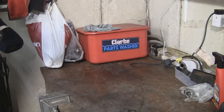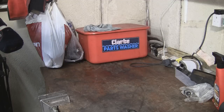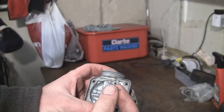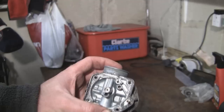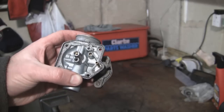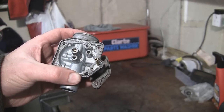Handy tip: please take a photo if you're thinking of doing this. It's alright for me because I've just filmed this, which will help me greatly if I've got any difficulties getting it back together. Just one little final thing I didn't notice happen - there's actually this pin that sits through the float here that actually dropped out when I undid the Phillips screw on the top and took the needle out. So make sure that doesn't drop out as it just did with me - that all needs to go back in as well. Just a quick note: I didn't realise it had fallen off and I thought it would be best just to amend it, just to show you where that goes back in.